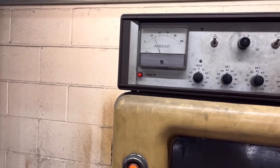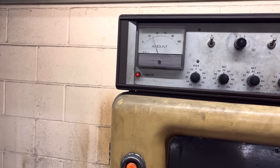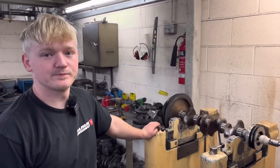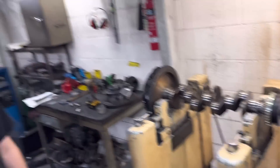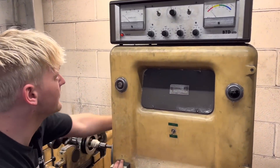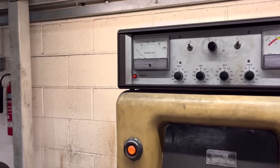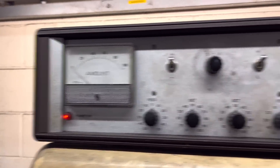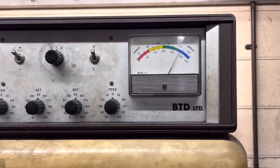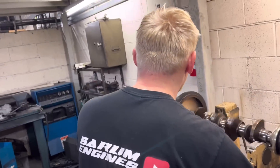So that's 25–30 ish. Going by that I reckon another two 8mm holes and that should be pretty much there. How have we got on? Yep, all balanced now — it's down to zero. So there we go: the amount is zero, the angle gauge is flapping all over the shop which means it doesn't know where it's out — which is a good thing. Show us the holes.